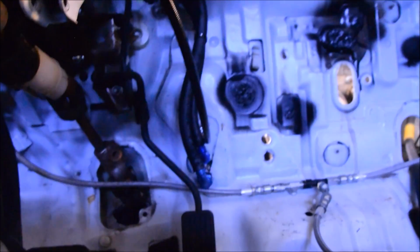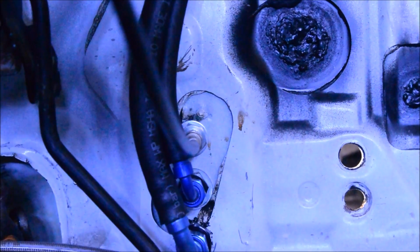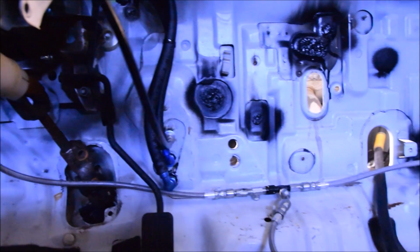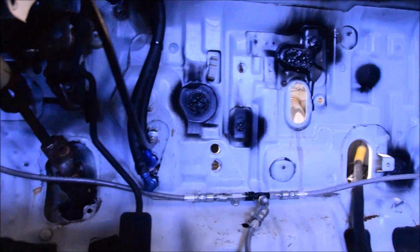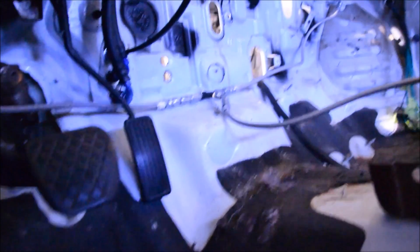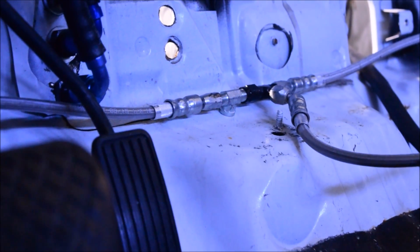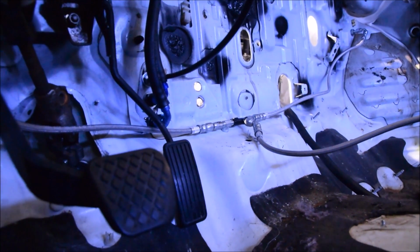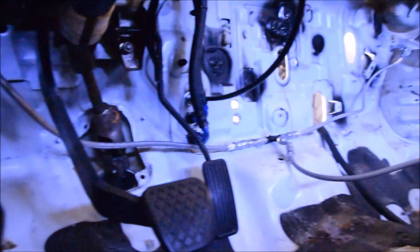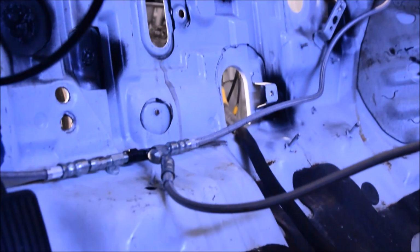And here next to the fuel, that's where we like to set our hose going out, and that's a bulkhead fitting. So you can see it's right between the gas and where the ducting would be for the heater or air conditioning distribution box, I suppose you would call it. Then you see we really like the central feed in terms of the brake hose. When we do a central feed, the hoses on both ends are the same length, and they actually end up being the same part number, and that helps in terms of cost and manufacturing here in the future.